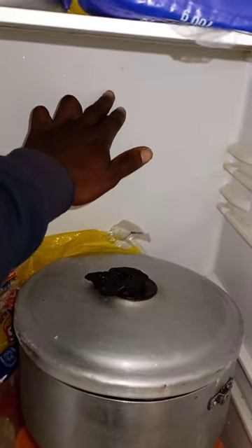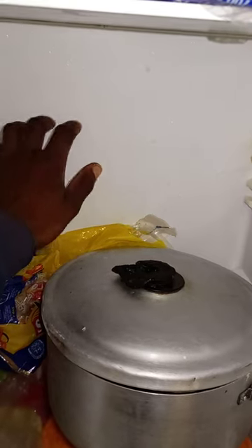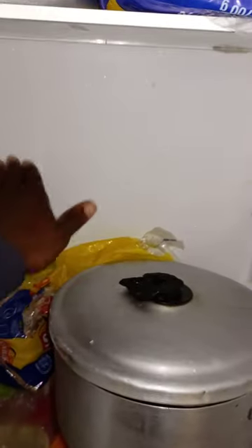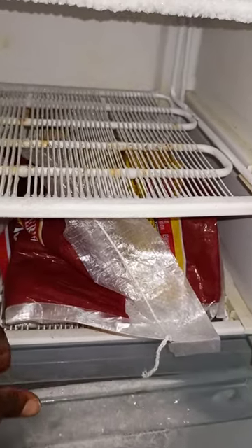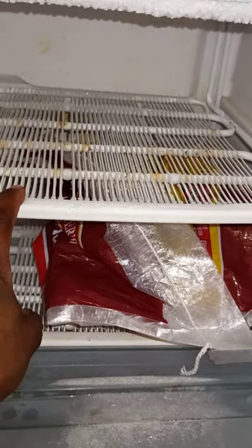So here at the back of this fridge, you can see there was frost and now it's melting. As the temperature drops it's going to start again. Here at the back there is an evaporator which is joined to the freezer evaporator, which is joined to this evaporator — the freezer evaporator. So when this fridge leaks on the cooling system, it will either leak here or it will leak at the top.